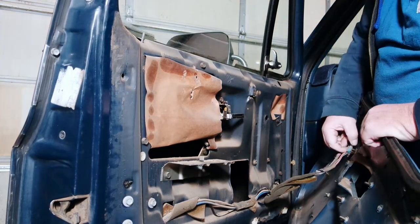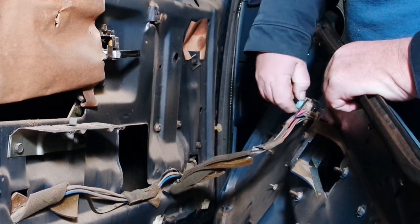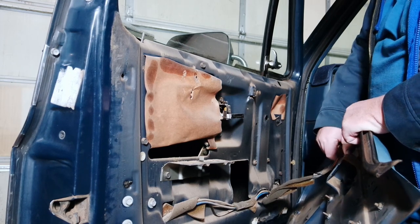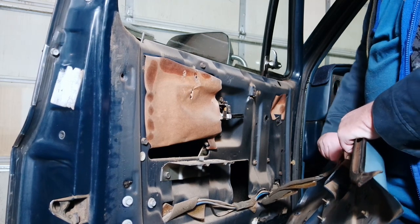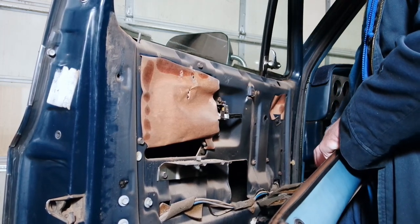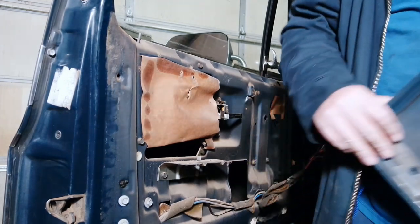Now that we're off, you're going to take this little blue plastic nut off of here, off that one, then off the other one, off our switches. Then gently pull these off — just rock them back and forth; they're probably stuck on pretty well. You could pry these off with a screwdriver, but make sure you've disconnected the battery if you do that. Door panel is successfully off.